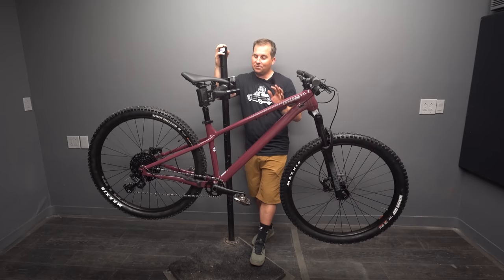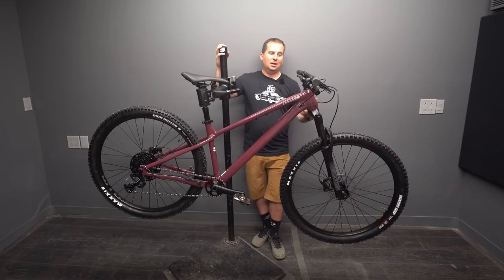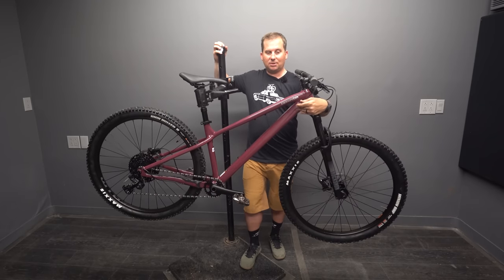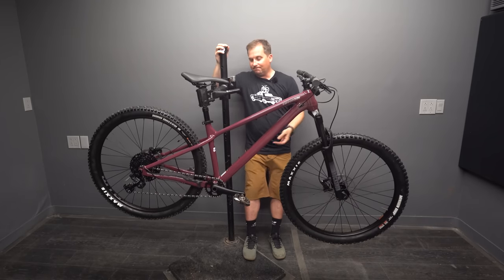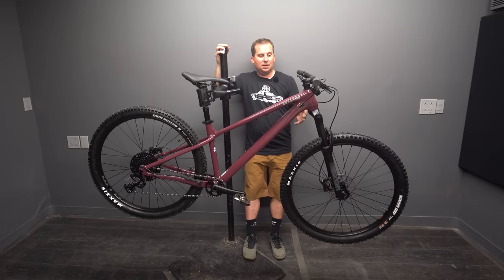To hit the under $1,450 price tag, you've got to make some compromises. You can't have amazing everything. One place I think they could do a little bit better is on their assembly. Like, the cables are a little bit long. The shifter cable went in the wrong port. That routing through the brake was goofy.